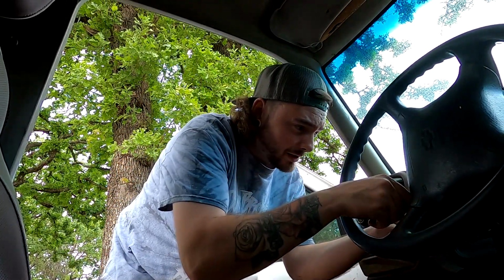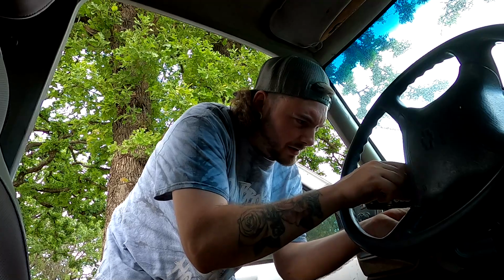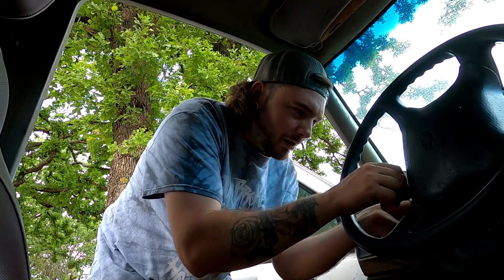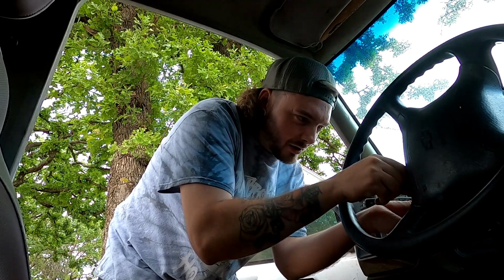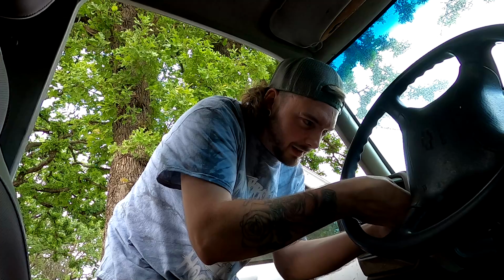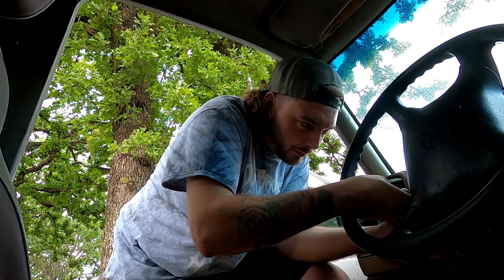I did do some diagnosing. I'm trying to set this up. I hope y'all can see me. I tried doing some diagnosing yesterday when we were messing with the headlights, and I did notice that when we were putting the core support and everything back together and hooking all the harnesses back up, the light harnesses, the signals wouldn't work and the hazards wouldn't work, but if I put my foot on the brake pedal, the running lights would come on up front. And then I can't remember what we did, James might, but I'm pretty sure we just wiggled a ground wire or hooked one up or something, and it started working. So I kind of thought it was that deal again. I got a high beam that's not working on one side, which I hooked up a ground, and then that high beam started working very dimly. So man, this is a pain in the ass. Not as much of a pain in the ass as pulling the steering wheel, so we're gonna go for it.